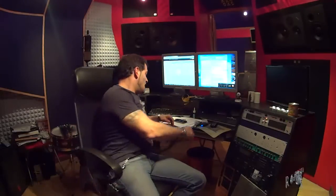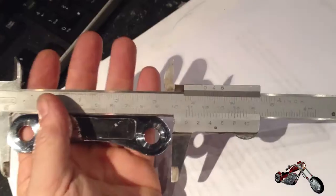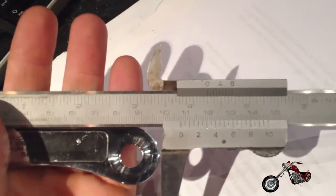Once the original model has been created, I need to verify the dimensions by accurately measuring the original with the caliper and scaling the drawing to the size of the original part. Once I reach a satisfying level of accuracy, I usually print the piece and try to fit the original onto the paper version.